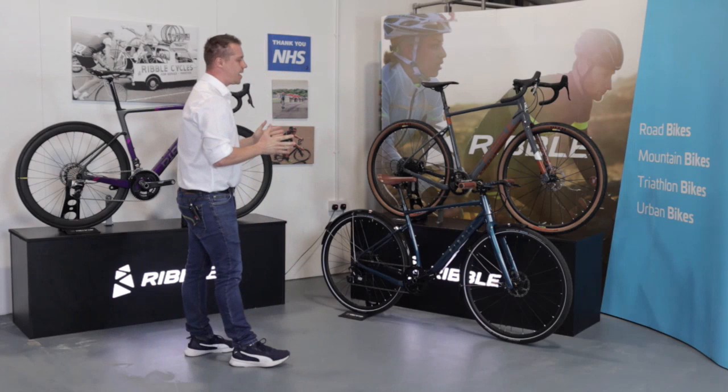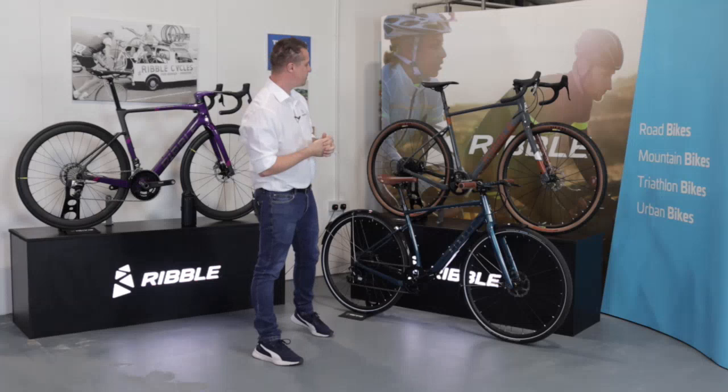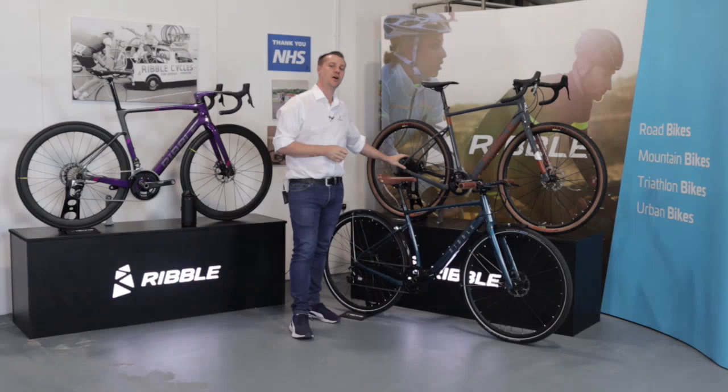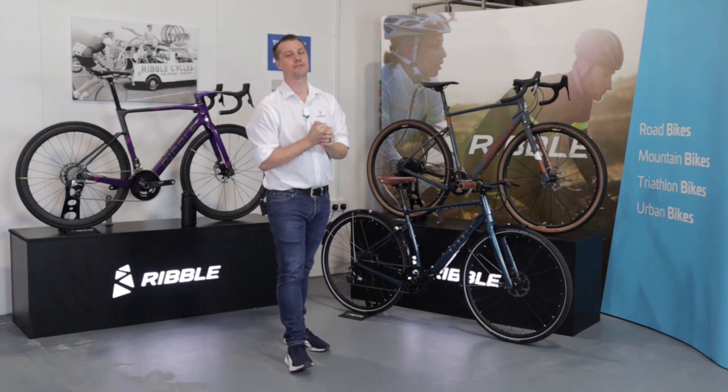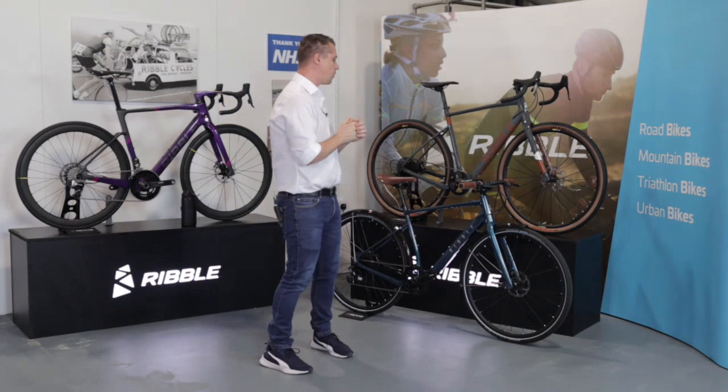And then as you can see, these guys here carry that e-bike motion X35 electronic drivetrain system, the pedal assist system in the bikes, which from the outside you can't even tell is an e-bike. The battery is built into the down tube with that rear hub offering 250 watts of power assistance level over three settable modes by yourself, through a Bluetooth smartphone app. Through the app, you will connect to your bike and dictate to your system how much power you want in each mode. There are three programmable modes, offering you the pedal assistance that you require.